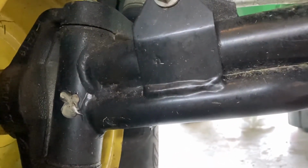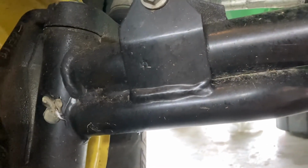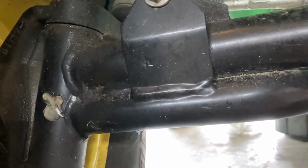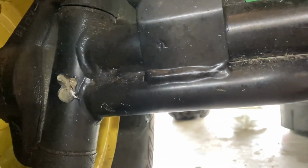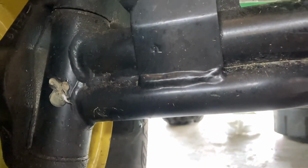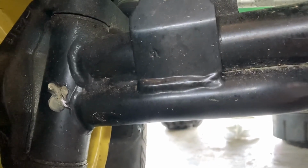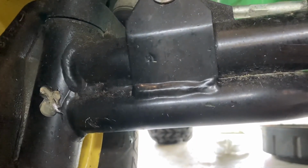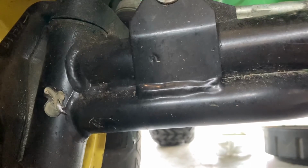And the oil change is done. I put in a couple quarts. It seems to check a little high after 2 quarts, which seems odd, but I guess that's the way it is. And I did go to full synthetic on the Gator this time, so we'll try to keep full synthetic in the future. 10W30, 3/4 wrench for the plug. The filter is as hard to get at as anything you'll ever change, and 4 grease zerks. That's what I found on a TS Gator so far.